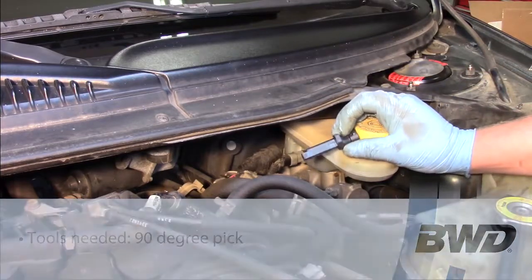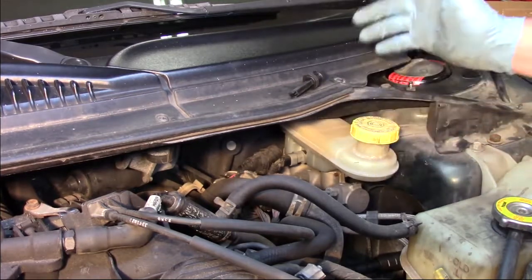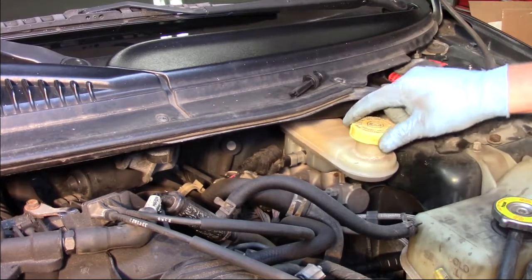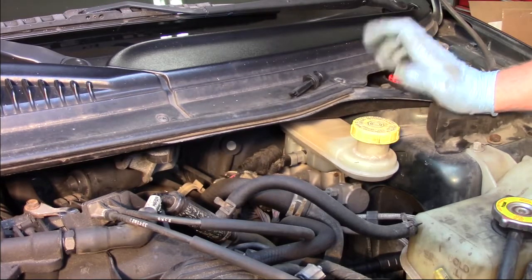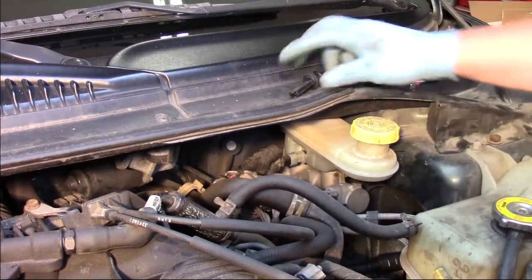As you might imagine, this is actually located inside the master cylinder. This is one of the reasons a red brake light may come on in the vehicle — it could be because the fluid level is low. That's certainly a good place to start; we want to make sure we've got adequate brake fluid level. Also, the parking brake could be applied. Those are good things to check before replacing your level sensor, or the level sensor itself could be faulty.